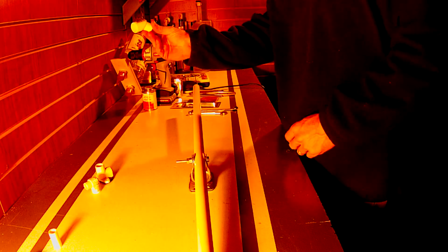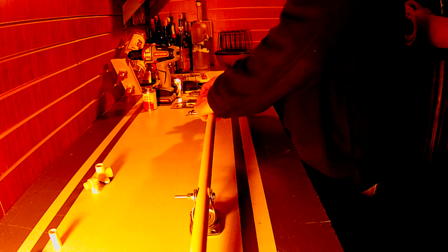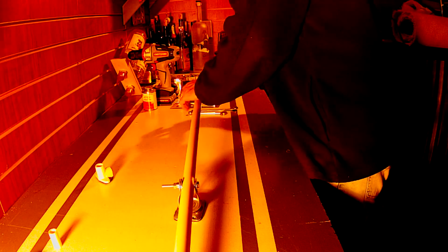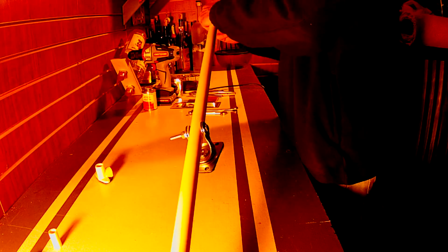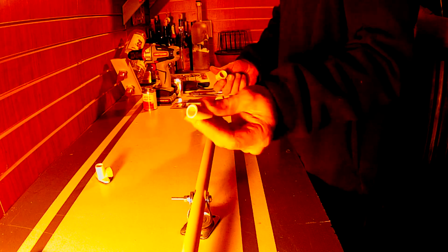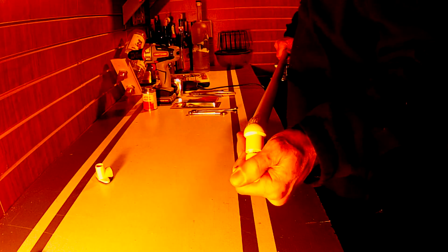And then we use our 3/4 inch to 1/2 inch 45. Line that up. We'll come back later and glue this on. For demonstration purposes, we're not going to glue anything yet. So then we've got that. This is your Street 90. Right here in the end. Nope, I told you wrong. Use your 1¼ inch piece of pipe. It'll go right here on the end. The reason for that was I wanted it to drop down a little bit from the pole so you didn't see the pole with the camera. So you got that. All this will glue together.